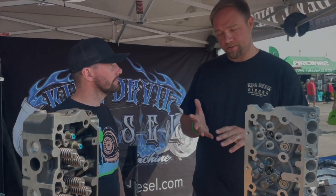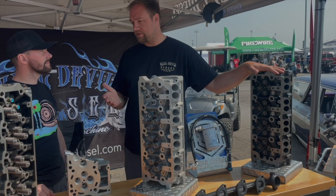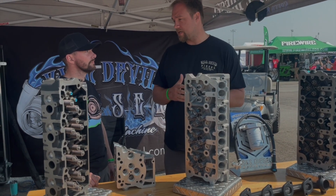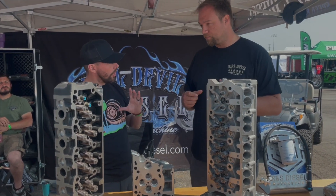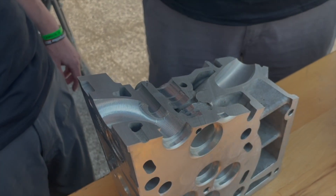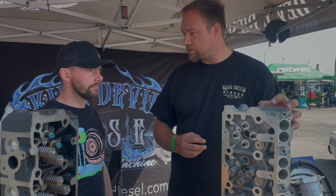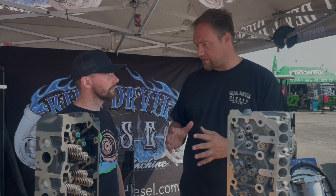We offer cylinder heads for 6.0 and 6.4 in a few different varieties. We have our old faithful iron heads — a huge reliability increase — with valve spring and valve upgrades available. For performance applications with upgraded turbo and injectors, we'd recommend our street port Icon series. Those flow what a ported factory-style head flows, right out of the box. We call them an as-cast head, and they are larger than a standard ported head — larger and redesigned. These have a dual layer water jacket, meaning coolant can circulate through the entire length of the head, eliminating the hot spots and deadhead areas, giving twice the cooling capacity and more than twice the surface area for cooling.